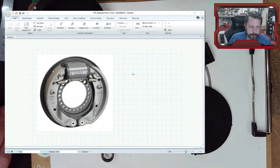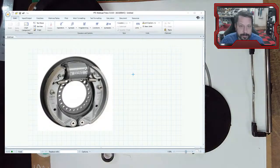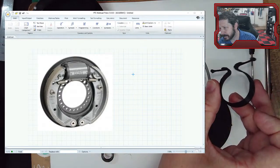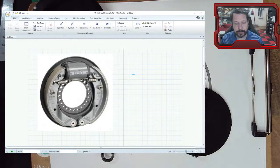Other parts include the cylinder. In this case they've got two brake shoes - one on the back and one on the front - and they're both connected to this cylinder in the middle. This is a hydraulic cylinder with brake fluid in it. When you press the brake pedal, fluid is forced into this chamber where two little pistons move outward and actuate the brake shoes, pushing them apart. In my model I have a little cam-type thing I can turn to push the brake pads apart, and there's also some kind of return spring.